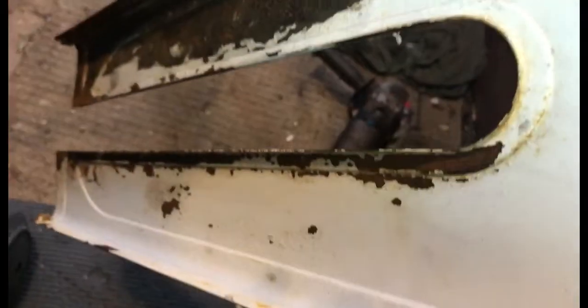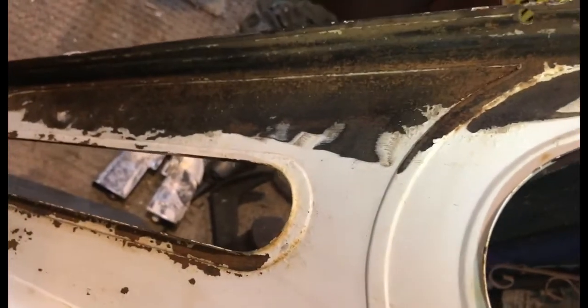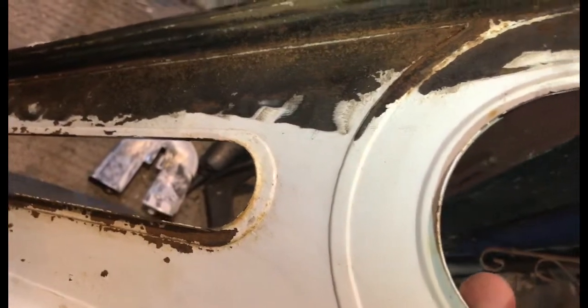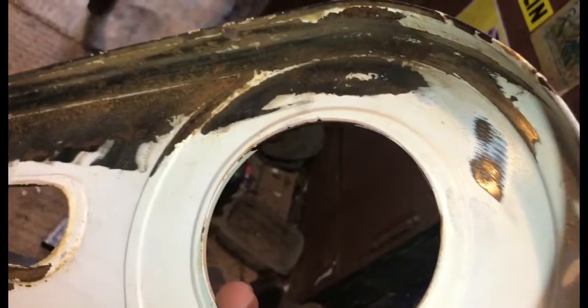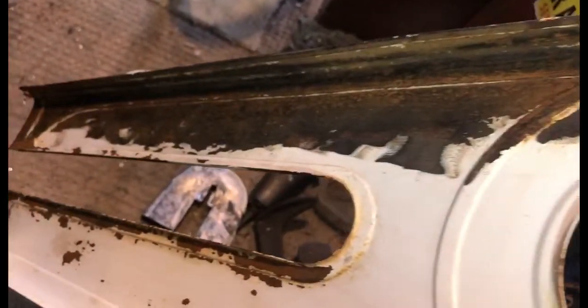The inside of this I'm not going to do in the white finish. I'm going to use car wheel paint. It's really sticky paint, very strong adhesion. Obviously it's meant for car wheels, so it's roughy-tufty, outdoor environment, keep-the-rust-at-bay type paint. So the inside is going to get that. Having white next to a chain is a ridiculous idea.